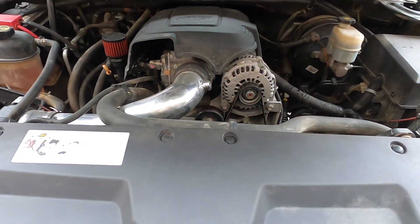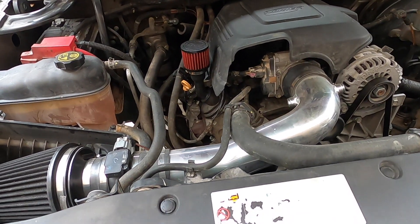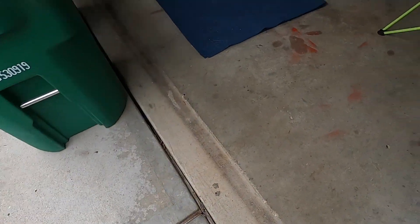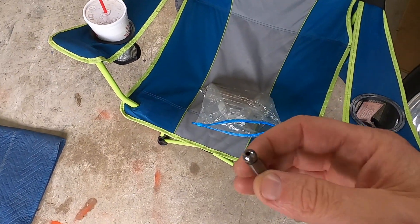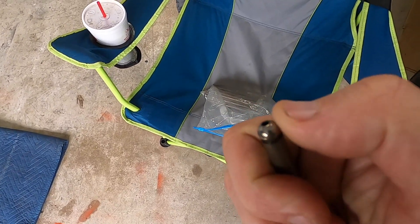I went on LS1 Tech and it's actually a pretty common problem on engines around 125-130,000 miles — the end of the push rod will get worn, it almost looks like it's been sanded. These are the push rods out of the LQ4 that are in the Cutlass that I'm going to replace those with. This little ball where it contacts the rocker will just look worn.